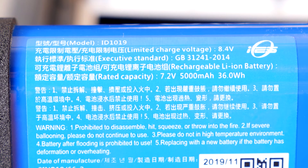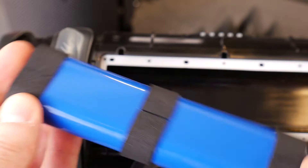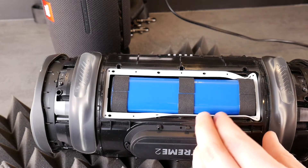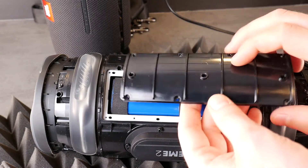You can buy a new replacement battery on Amazon or AliExpress — links to them will be in the description. Adding a new battery is as easy as removing the old one. When putting a new battery inside, keep an eye on the white insulating rubber. It makes sure that your JBL speaker is waterproof, so it should be properly positioned before screwing the cap on.